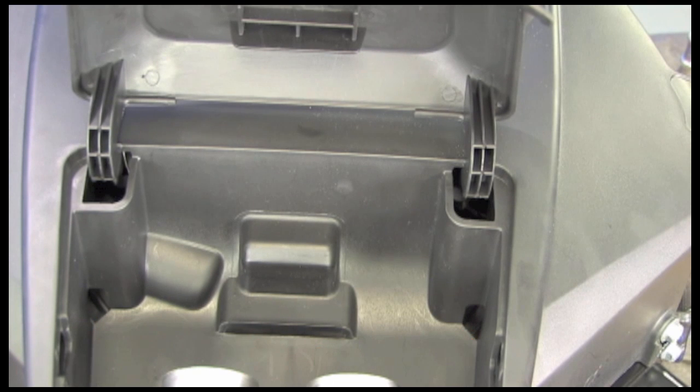The compartment has positive airflow being injected through these three openings from the overflow air being drawn in by the blower fan bolted to the flywheel. That airflow is generated by the spinning flywheel when the engine is running.